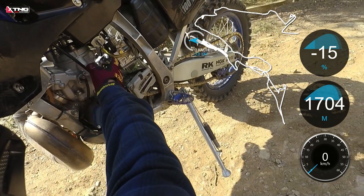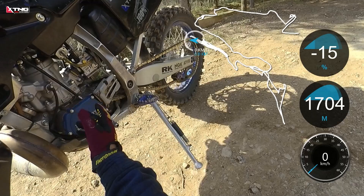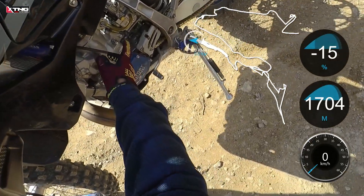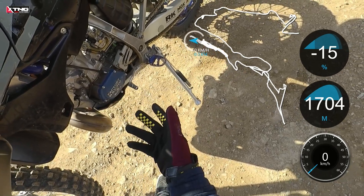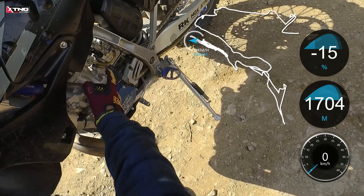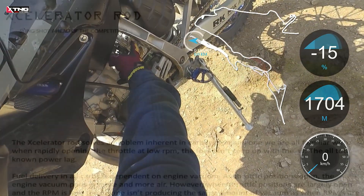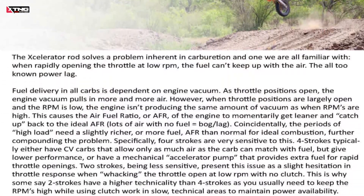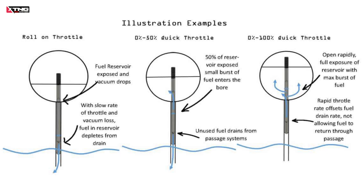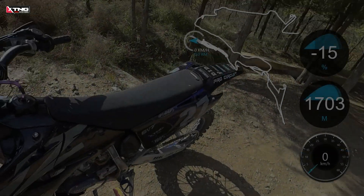Its predecessor is the renowned Lectron H series. The Billitron Pro was launched in 2023 and features a multi-fuel circuit system, including the torque gain fuel circuit and the power jet fuel circuit. According to the official description, the torque gain fuel circuit is designed to improve low-end torque performance. Additionally, this carburetor includes a new metering rod system called the Accelerator. The back of this metering rod features a fuel reservoir, a design that significantly enhances the engine's throttle response capabilities.